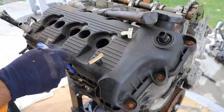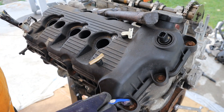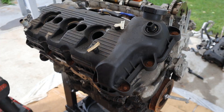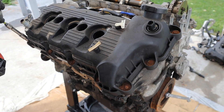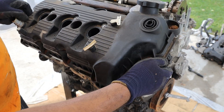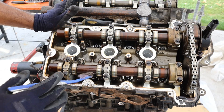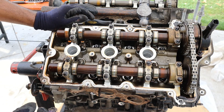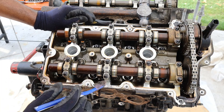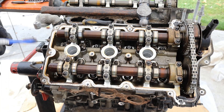Going in here to clean out all of these holes — the recessed ones were the worst on the front. This is not so bad back here because the plenum was covering it. I got them all loose. Taking a look onto the rear bank, just like the front things look pretty clean. This is only slightly more tarnished, probably because of the PCV system. We do have our timing chain and our oil control valve over here.